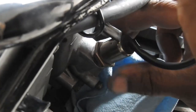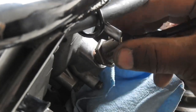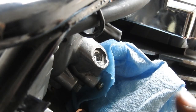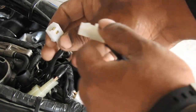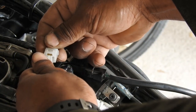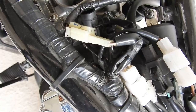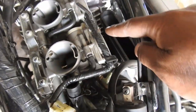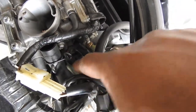Watch that the wire doesn't get twisted, and keep in mind there is a little washer underneath. Once you remove the solenoids one at a time, plug them back into their respective connectors and keep them to the back of the bike out of the way. Next, disconnect the thermal switch — that's connected to the carb heaters — and also disconnect the throttle position sensor.